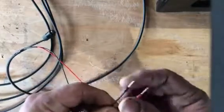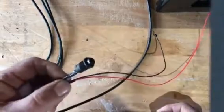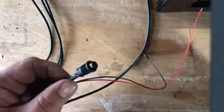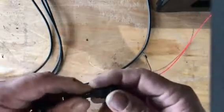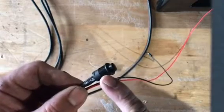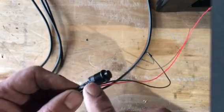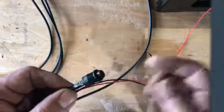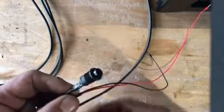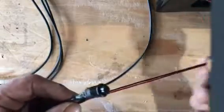You just need to remember the polarity. You need to obtain a 12mm drill bit — either steel or wood, makes no difference — but it has to be exactly 12mm, not 12.1 or anything like that, exactly 12. When you drill your panel, do so as close to your PMS system or your fuse box — your 12V supply. It must be a fused supply; it cannot be an unfused supply, to protect your cable from any fire risk or issues.